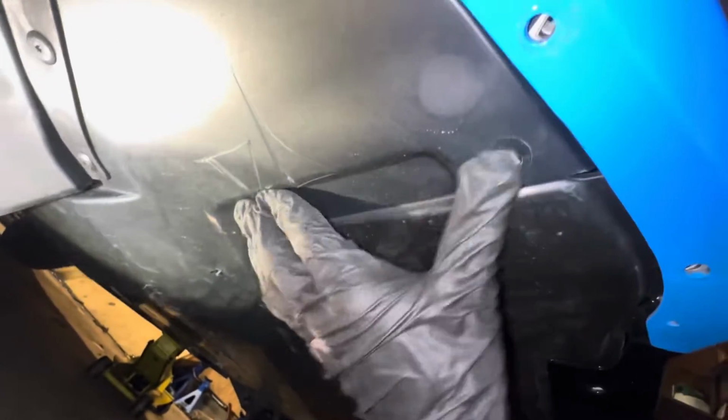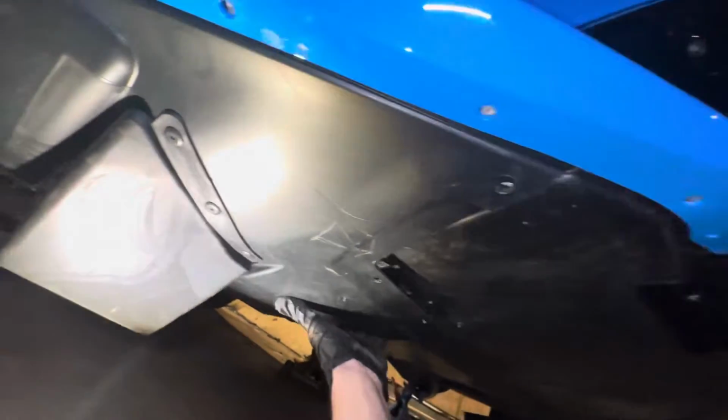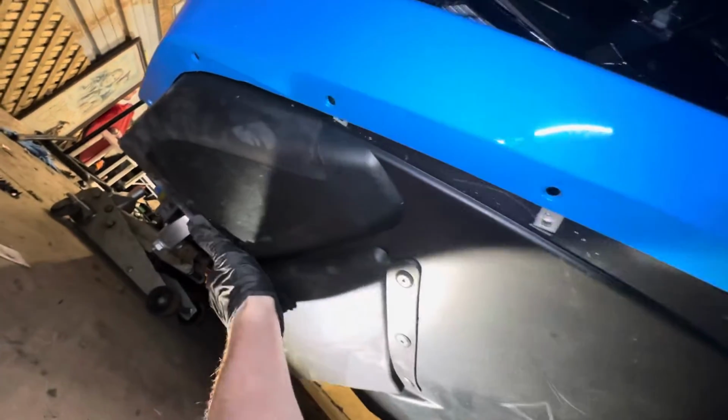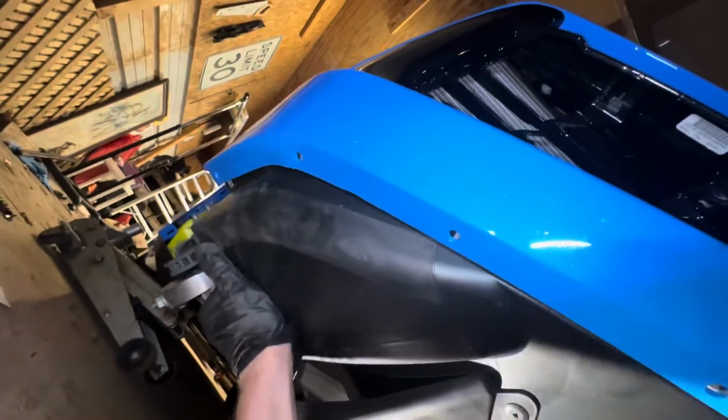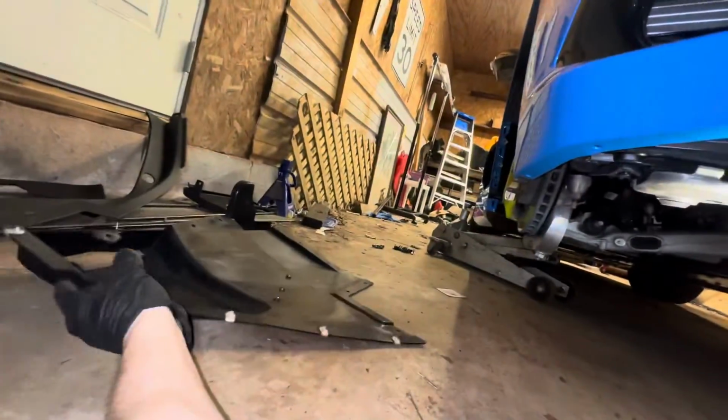The panels on the sides are going to be coming off first, and there's just like 1, 2, 3, 4, 5, maybe 6 little T15s back there holding on, and then you should just be able to kind of wiggle it out of the bumper and pull these off. It might take a little finessing, but it should just slide right out. All right, and that's what the panels on the side look like. But yeah, now we get a good look at everything up under here.